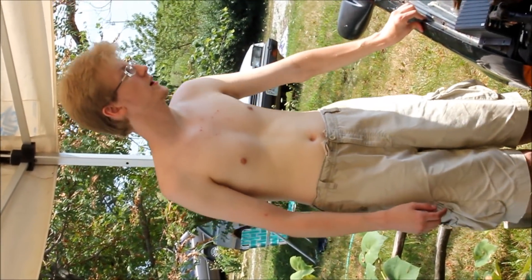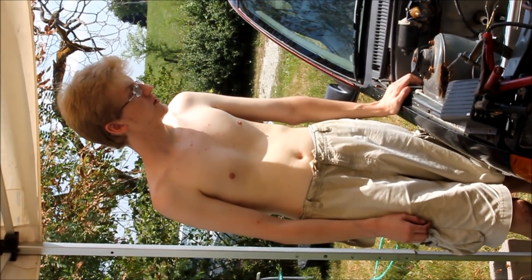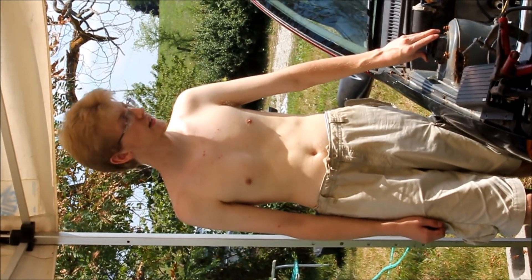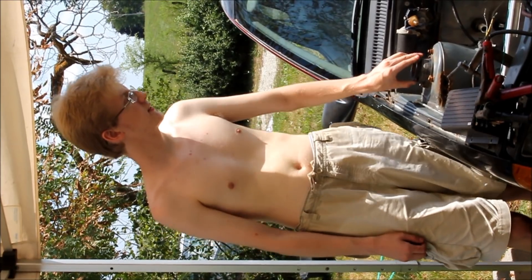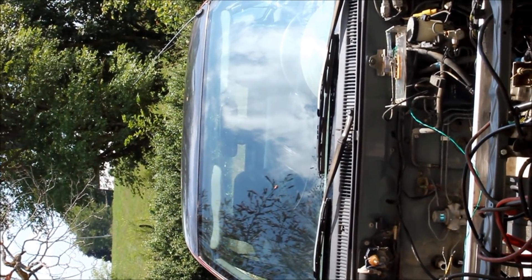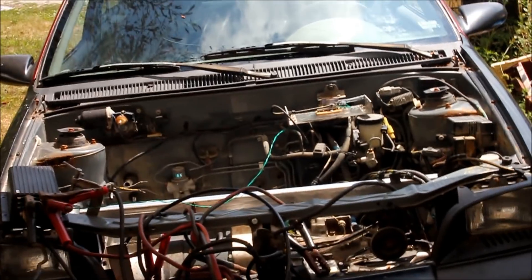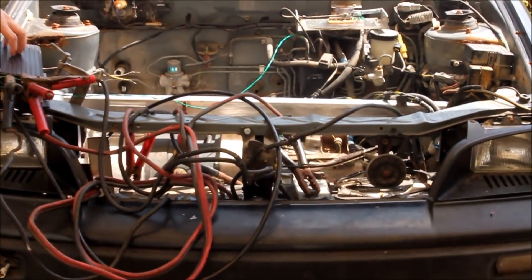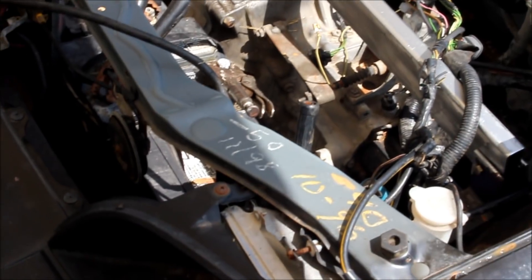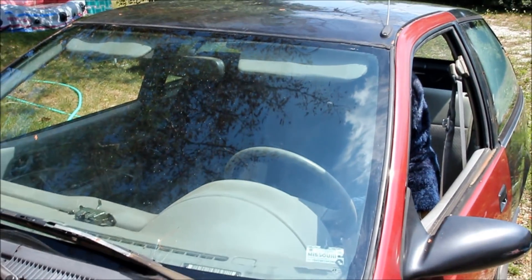Hello, my name is Donovan Gibson and this is my Electrogeo project — it's been a year and a couple months in the making. Today we're going to test drive it. Here's a homemade throttle box, which isn't working particularly well but works to some extent. We have 36 volts of lead-acid batteries and a Curtis 1205-117 controller, which is a 400 amp, 24 to 36 volt controller. We'll show you how it runs.